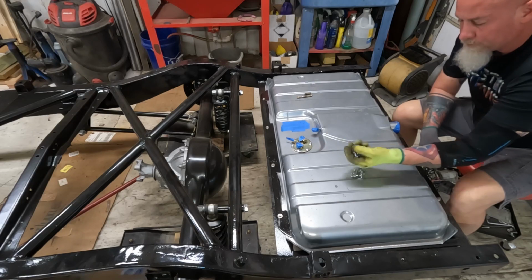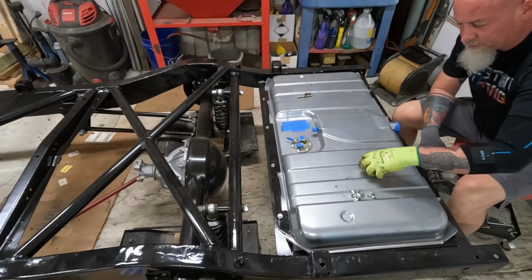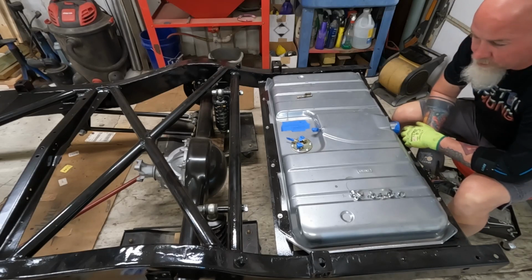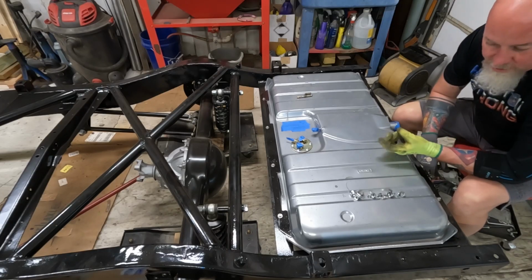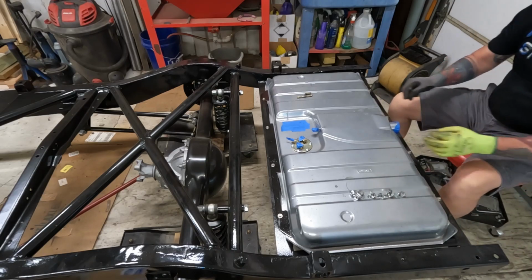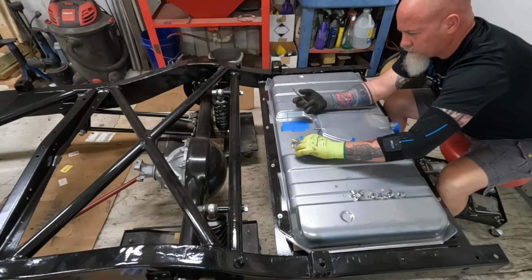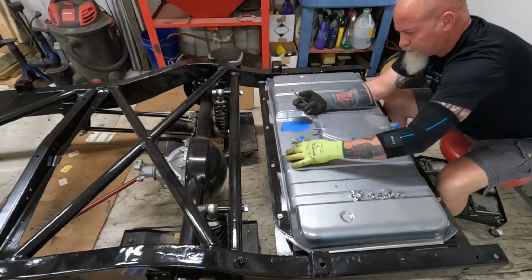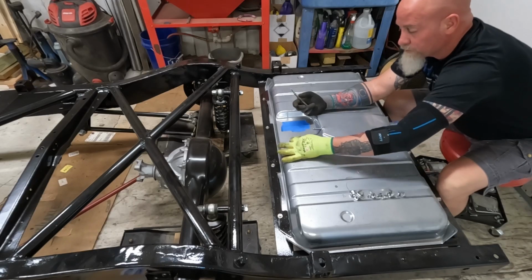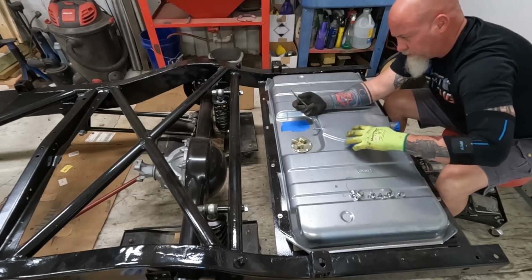So spring clamps or screw clamps like this will be fine. On the fuel injection side, we're running higher pressure, so we're going to have to use fuel injection line clamps, which is our complete 360, or the fittings. We got a couple of fitting problems with the fuel pump and all that other stuff. It's not set up for AN fittings, so we'll be using clamps.